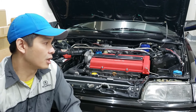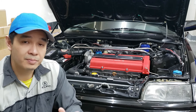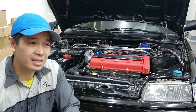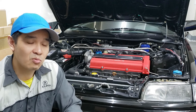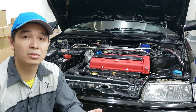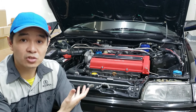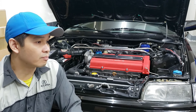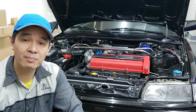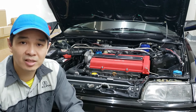The D16Y8 feels like you could be ripping it around like in a go-kart. The B18B1 is a lot quieter on the highway due to the long gears in the LS transmission. Between the two engines, the D16Y8 definitely drove a lot better — if it wasn't for the oil burning I would have probably kept it. There is also a difference in that the D16Y8 was running a tuned street map, so it does feel better because it's tuned. This B18B1 is running the stock P75 ECU — the stock tune — and it has potential for more power with a chipped ECU and a tuned map, but I enjoy driving it as is, exactly how Honda intended.